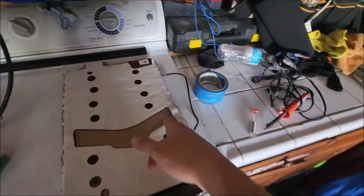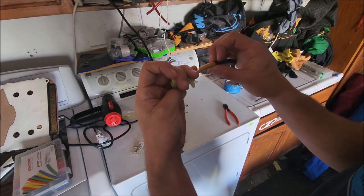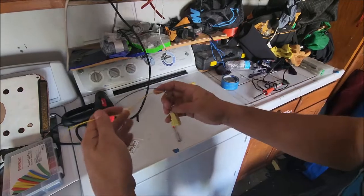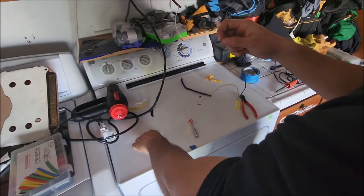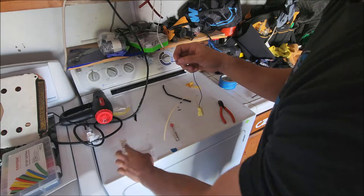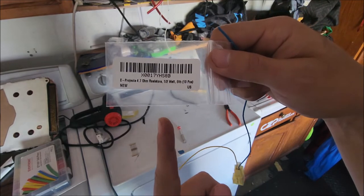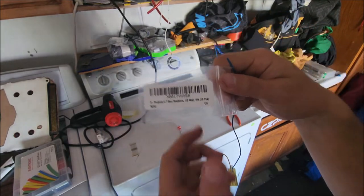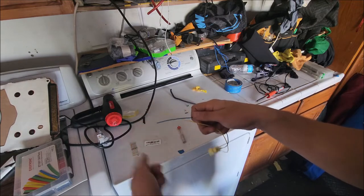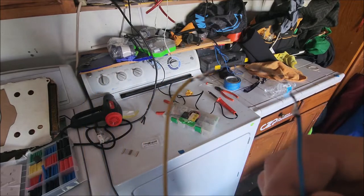Once you've snipped the sensor from the passenger seat, it's pretty much just a piece of tape — you're gonna want to unroll this. We're pretty much gonna wire it together with the resistor. The resistor you need is a 4.7 ohm — not 4.7K, 4.7 ohm half-watt. Get your wire strippers, strip these, tie them to the resistor, solder them together, and then you're good to go.